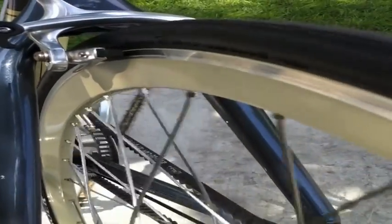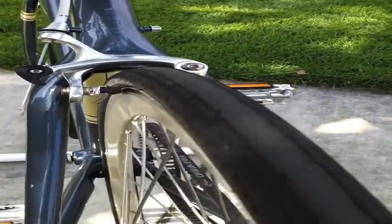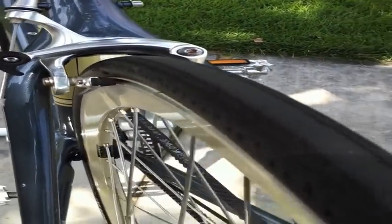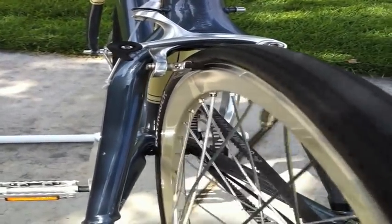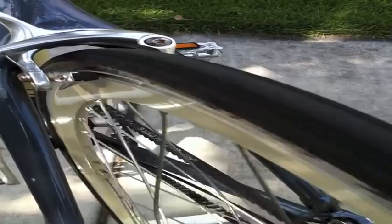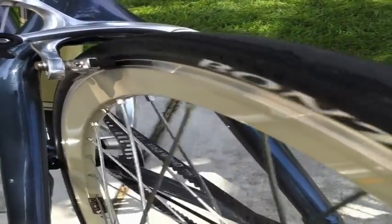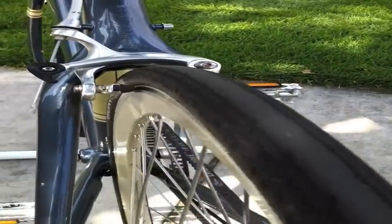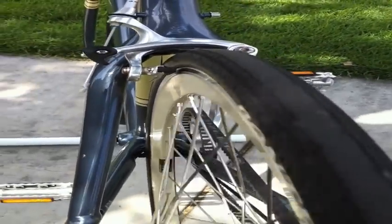Okay, so I didn't have a truing stand, so to true up my rear wheel, I just ended up using my brakes as guides. Sheldon Brown mentioned you could do this on his website, which I really appreciated, his heads up. So I just adjusted the brake all the way over on one side and really watched to see where it hit and where it lined up. I spent a little time just adjusting, and it seemed to work out just fine. So I've got the wheel right dead center, as true as can be. And like I said, 50 miles into it, and it's going awesome.